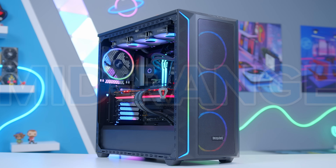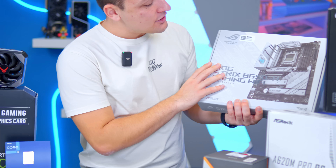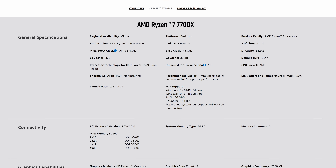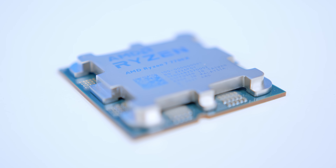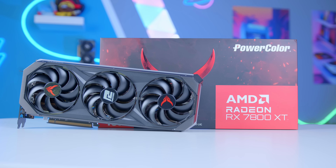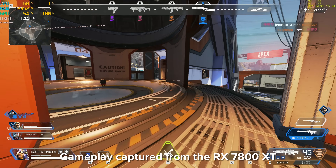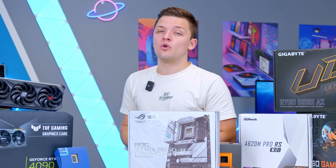If you've got a bit more money to spend and want to go a little further, I'd swap out that B650M Plus Micro ATX motherboard for something larger and more feature-packed, like the Strix B650A Gaming Wi-Fi, and notch the CPU up to the Ryzen 7 7700X. The 7700X gives you a couple more cores over the 7600X — great for productivity-oriented tasks and more recent AAA titles that are more multi-thread optimized. GPU-wise, add the RX 7800 XT: one of AMD's most recent GPU releases with 16GB of video memory, a fairly compact dual-slot form factor, and superb rasterization performance. It beats out the 6800 XT it replaces, not by huge margins but by enough to make a difference, and with that high VRAM you're more than good enough for 1440p. This is probably the best combo you can build right now for a 1440p-oriented gaming PC.